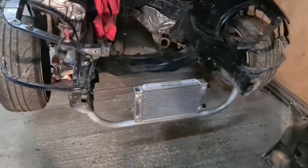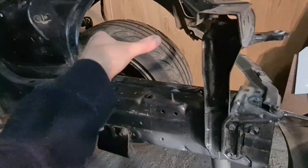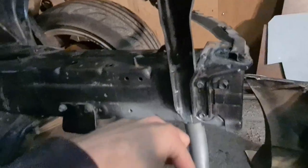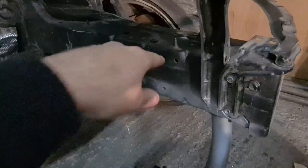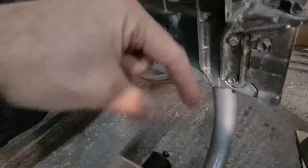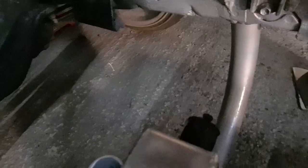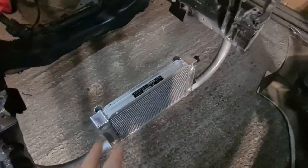And then I've got my oil filter relocation, which used to be on top of here, facing up, but I'm gonna have it here facing down, and then literally it'll just come straight out into here, which I know is a tight bend, but I'm using nylon. Plus also, it doesn't matter about the movement of the engine from those two, because it's literally a hard mounted point with a pipe in between, so that's all right. And then the lower one to the engine, I'll have it a nice length, so the engine can move, and then this pipe isn't under any stress. But that same setup worked for 3 years, so I'm basically keeping the same, just making it better and a bigger oil cooler.